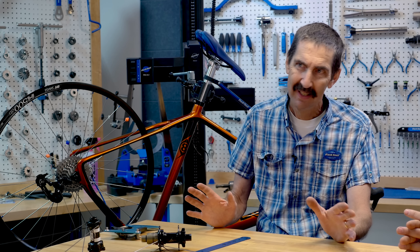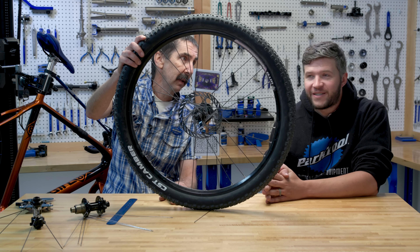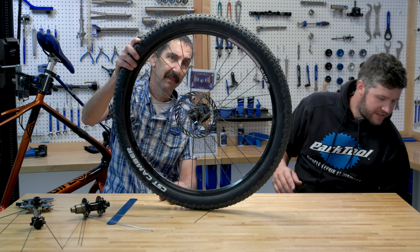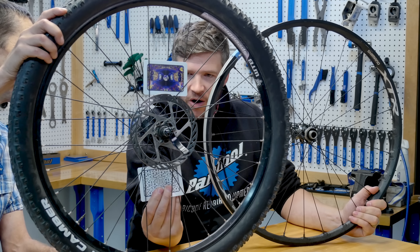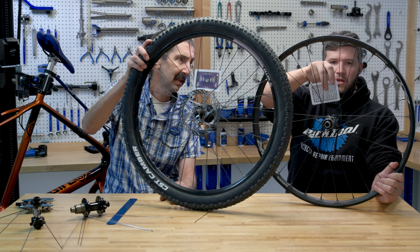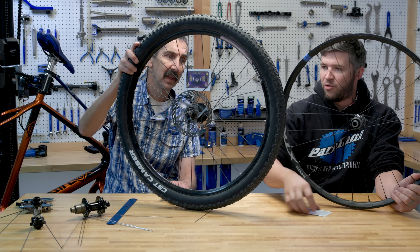So generally if you're building a straight-pull, don't bother interlacing. Here's a fun one though - this is interlaced, and it makes it a lot of fun. Another reason for interlacing: if you don't interlace and you want to shove something fun in your spokes like a reflective corner, it's just going to come flying out. No fun. But with interlacing, it gives you two spokes holding together and pinching it in.